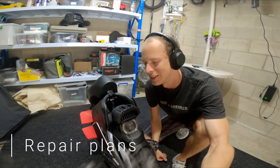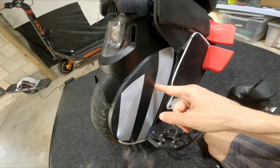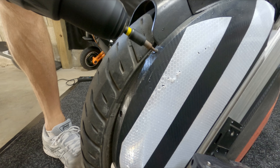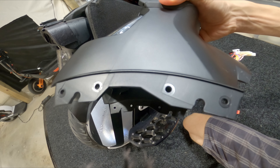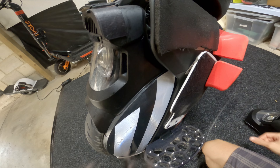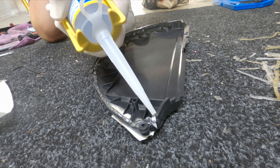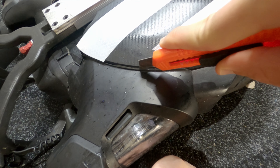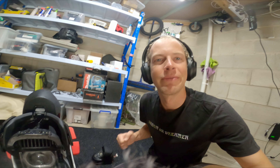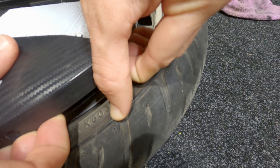The light's here already, if you can believe it. So we're going to be installing this one and it looks like the side cover needs to come off — these screws — which means we have to take the side saddle off, the seat, and then there will be four bolts. Unplug the wires and that should come out. Now the problem I'm seeing is that I've siliconed around some of these seals to make it watertight, so breaking that silicone is going to be a bit tricky. This is what I was worried about — the silicone waterproofing makes maintenance really hard.